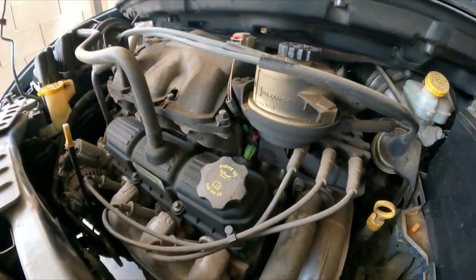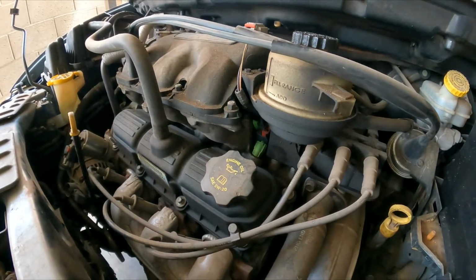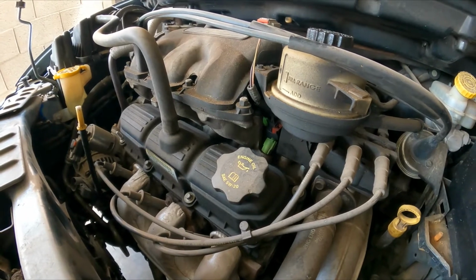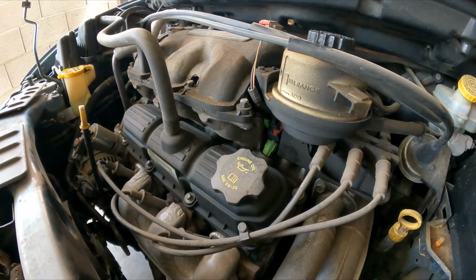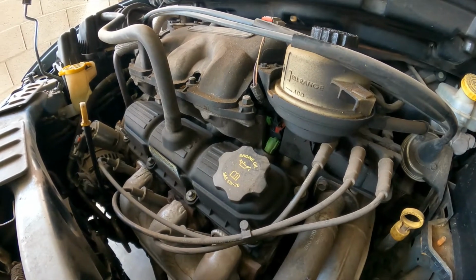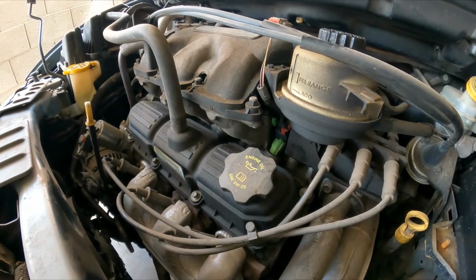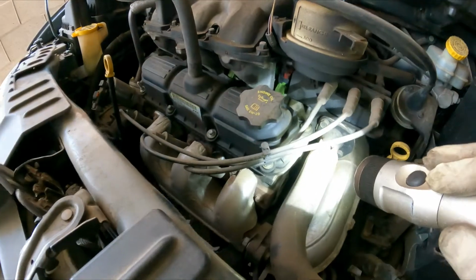And I see many times the technicians or people complain about oil leaks and say, hey, the oil pan is bad. And they fix the oil pan, the customer goes away a day or two, and then the customer comes back and says, hey, I still have an oil leak. And after that, they're like, oh yeah, you have something else going on. Okay, so to prevent that, you have to start from the top.